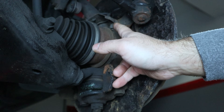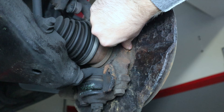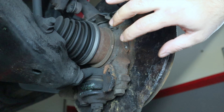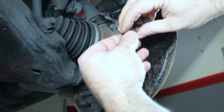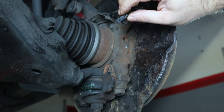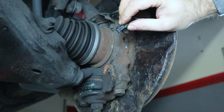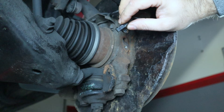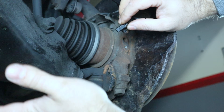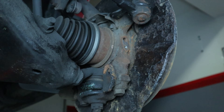Now that is a flat surface — really hard to see on camera but you've seen the flakes fall off. This is what actually pushes these sensors out. Don't try to just remove the sensors — do this to protect them, because you'll always end up breaking the sensor. These sensors can get a little expensive, so unless you have an issue don't worry about it. Even if you see a gap, sometimes it's small enough it doesn't cause an issue. But if you start getting codes, that's when we have a problem.